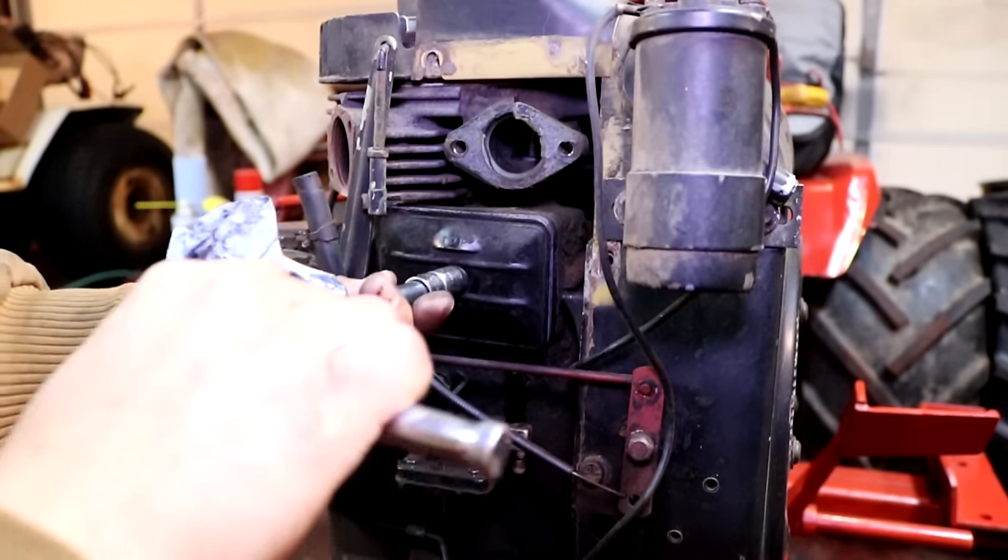Before we put the cylinder head back on the engine, first I want to clean off the underside of the cylinder head using a plastic scraper — just scrape off as much of these carbon deposits as you can. Then we're going to check the cylinder head for flatness. To check for flatness, put the cylinder head against a flat surface such as a granite surface plate, a granite countertop, or a glass countertop, and see if you can slide a 3-thousandths feeler gauge under the cylinder head between the bolt holes. If you can, it means you need to reflatten it. To reflatten it, use a granite surface plate or glass/granite countertop — put a piece of sandpaper on it, wet it down, and slowly sand it back and forth until you can't slide a 3-thousandths feeler gauge underneath the cylinder head anymore.